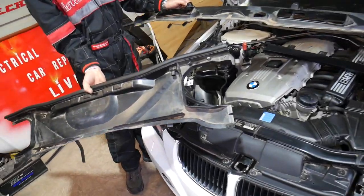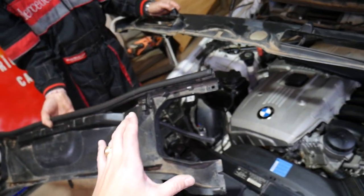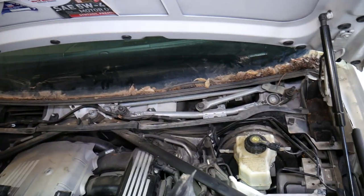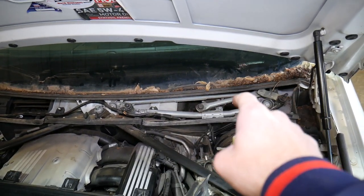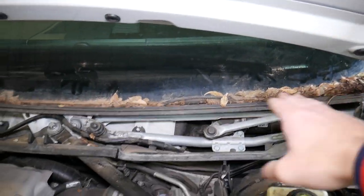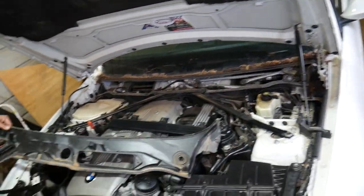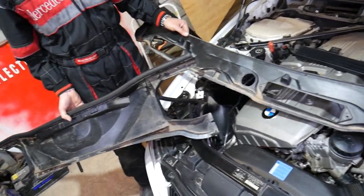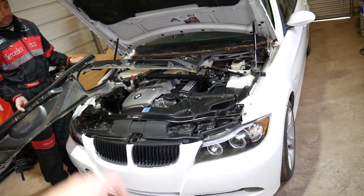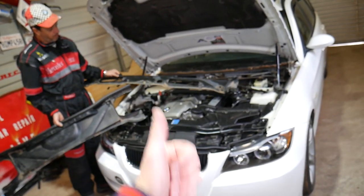The cowl piece came out just like that. This is the windshield cowl trim piece — the lower one and the upper one where the windshield wipers sit. When you remove it, you can access multiple components: the windshield wiper linkage, the windshield wiper motor, and the engine is wide open. I recommend taking this time to clean everything out — vacuum it and wipe it down, otherwise your car may trap moisture around the windshield. Installing it is in reverse order. If you have any specific questions or want to see a specific video, let us know. Thanks for watching — please subscribe for more help!